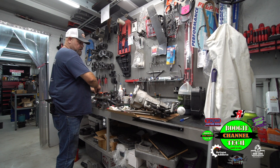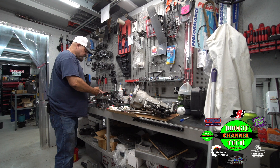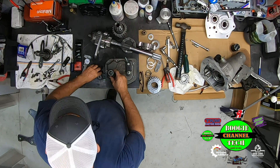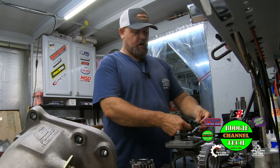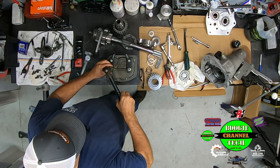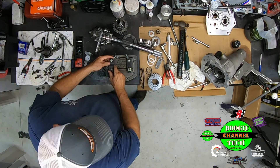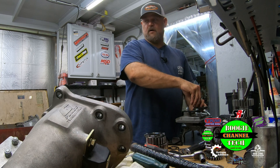If you have a 101A or just a 101 G-Force transmission, definitely come check these arms. This one right here is not as bad, but it still shouldn't be that way — they just wear with use. You can't hardly get the new one on there, so tap it on. There we go — no play in it now. You're good to go.